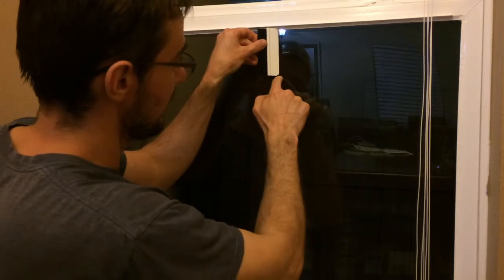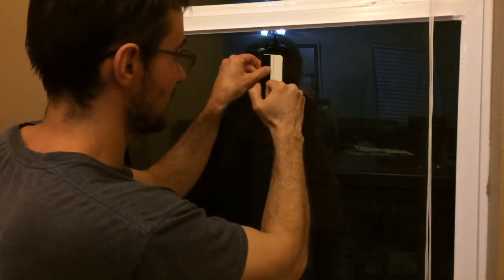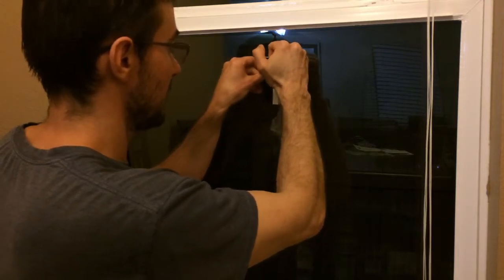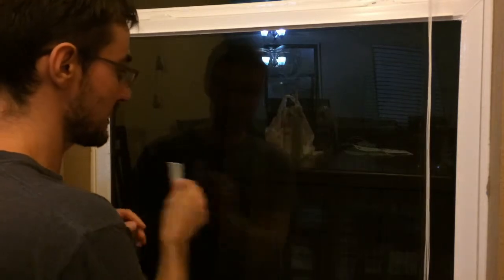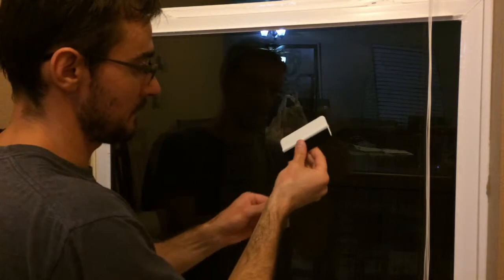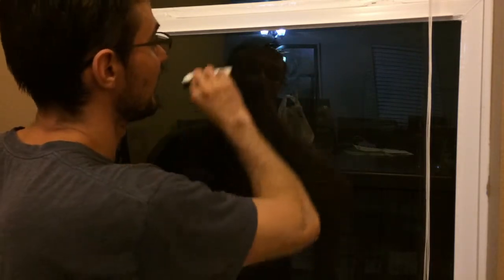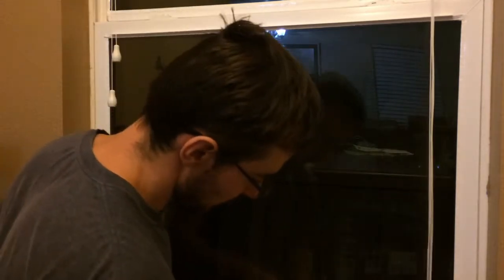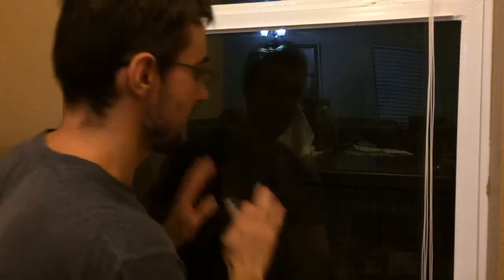You want a lot of overlap — so if your tee started here, you want to be further along on your next scrape, so that if some water is trapped back there whether you see it or not, it's going to be harder for it to escape your swipe. One pass soft, good overlap, all the way back to the middle, all the way out, drawing a little bit of water as I go, a couple of rows down, being real consistent with good overlap all the way down. Next pass: paper towel, hard side, really pushing with nice hard pressure all the way down, drawing. Then a final pass with a lot of pressure. After that's set for a little while, go through and clean out the edges and dry them — sometimes there'll be a little bubble trapped on the edge, especially with a little bit of dirt under the gaskets, which might creep out and cause it to lift up a little bit. Try to clean those up now that you've really forced out all that water. That gives you good optical quality.